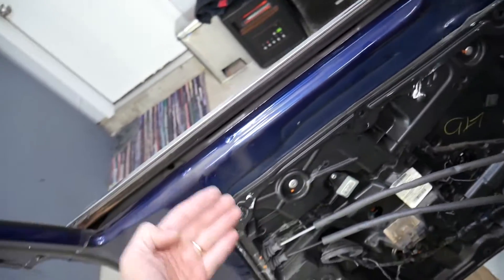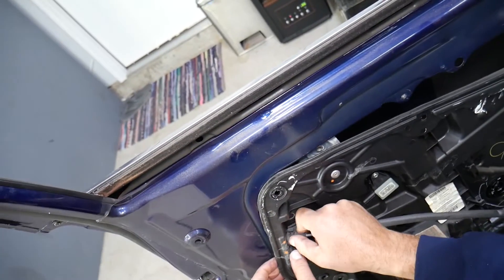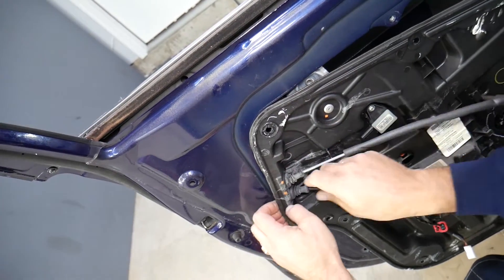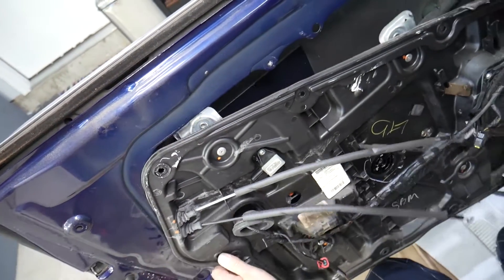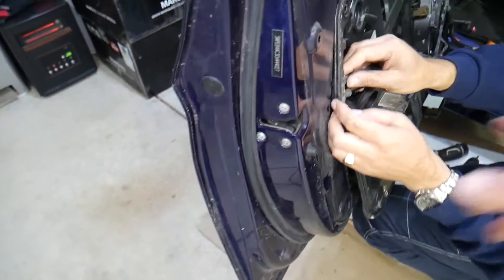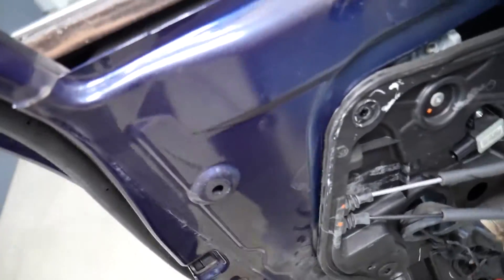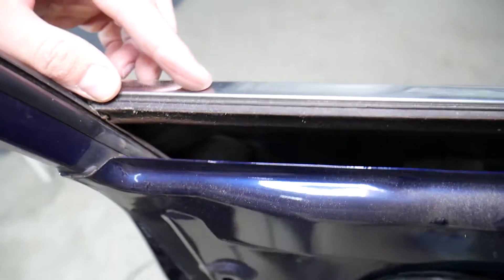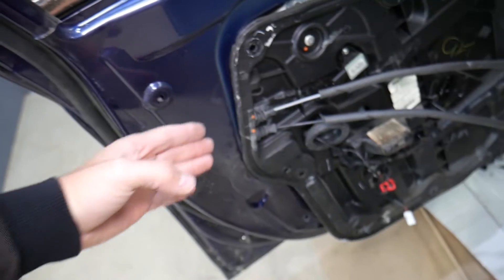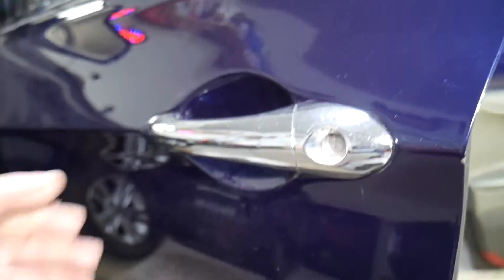The wiring harness came loose but it's stuck from the glue seal. The window regulator is visible here. Bring it down and pull it down a little — on two points you have the window regulator seals with the lock cable and the release cable. In some cases you may need to remove the door lock actuator.